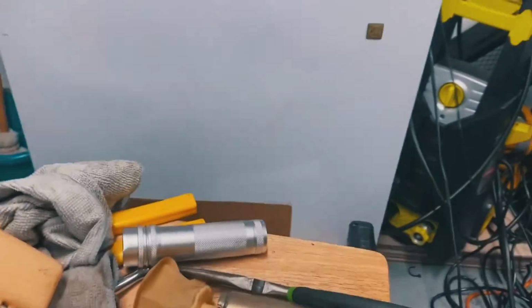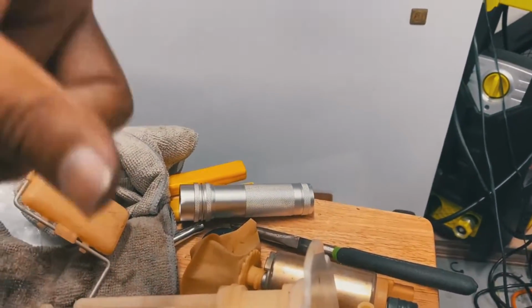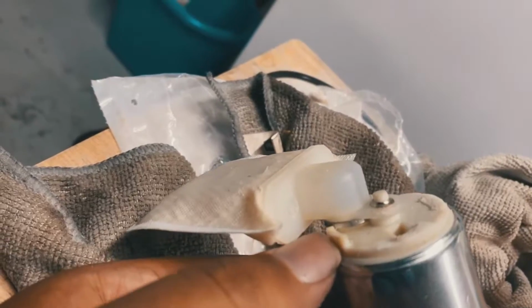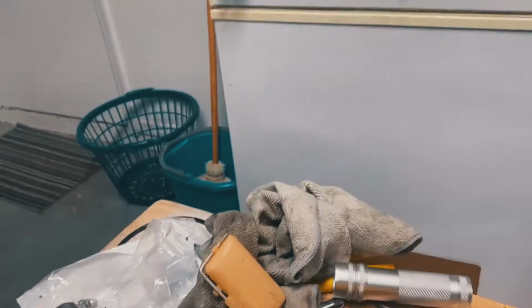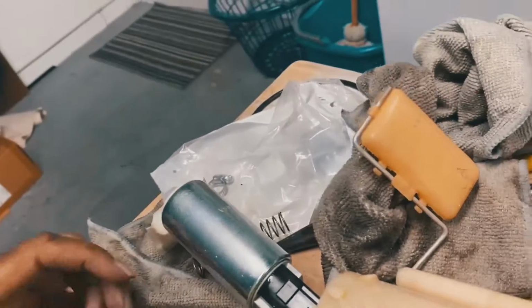So as you guys can see, after doing a little bit of research, I found out that specifically with the Walbro, because they are bigger than the stock, not really wider, but thicker and longer, apparently you gotta cut the teeth. You gotta Dremel down the teeth that are here, because this is what's causing it. They also said you have to keep the stock rubber grommet that goes on the bottom of it, in order for it to come together. You can't use the big thick one that Z1 gives you, okay?